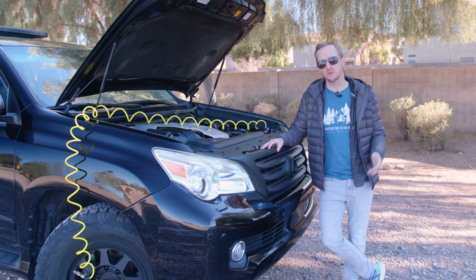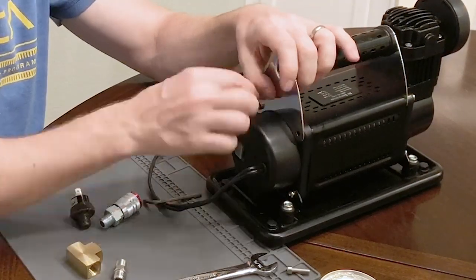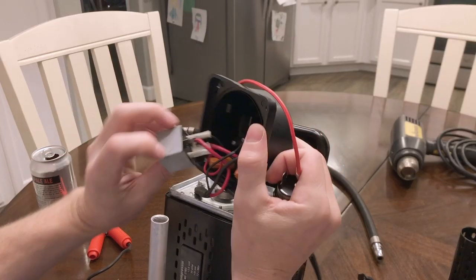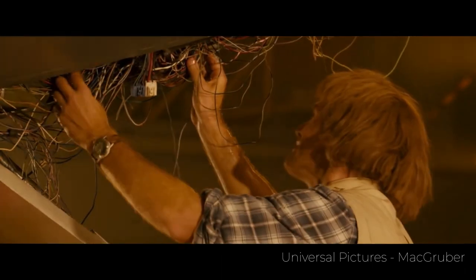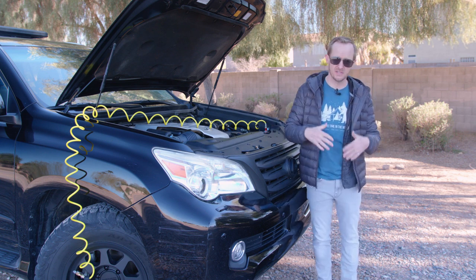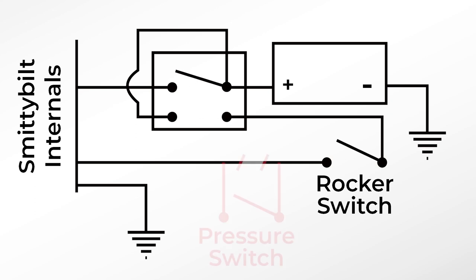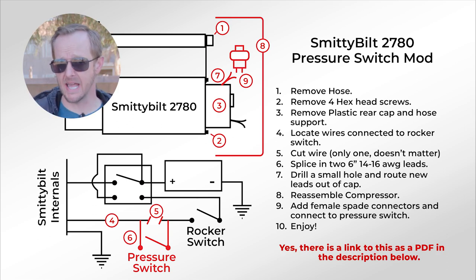I was a little vague in that previous video on the wiring, so I'll try and clarify that a bit here. To add a pressure switch, you'll need to remove the plastic cap that the rocker switch is mounted to on the end of the compressor. That requires removing four hex head screws as well as the bracket that the output tube is connected to. Behind the plastic cap you'll find the compressor's wiring and relay. Cut one of the two black wires connected to the rocker switch — I don't think it actually matters which one — because adding a pressure switch, you're just adding another low amp switch that opens up the circuit when the pressure gets to 100 psi and then closes it again when it gets down to 70 psi. I did it on the hot side of the switch. Here's a wiring diagram of the Smittybilt and here is how I modified it to add the pressure switch. Now if you're still confused after watching that last video and these additional details, you probably shouldn't be taking DIY electrical advice from a dude like me on YouTube.